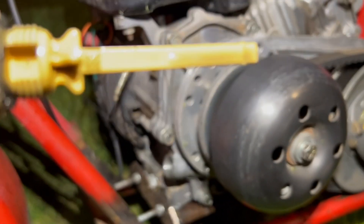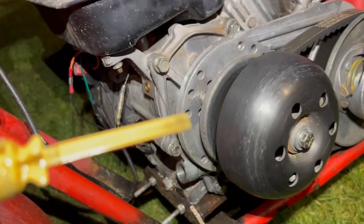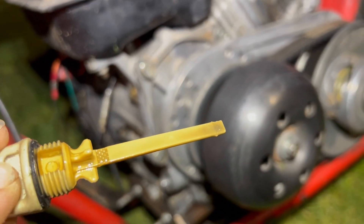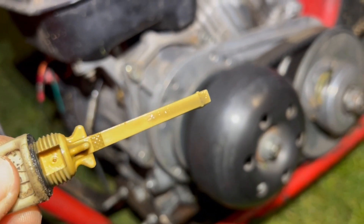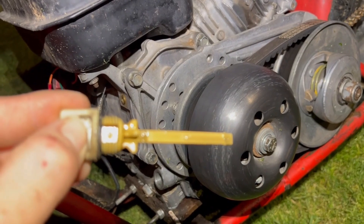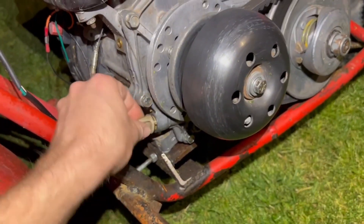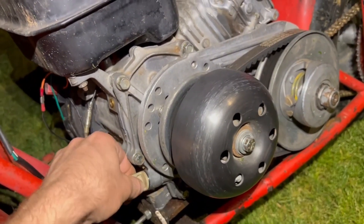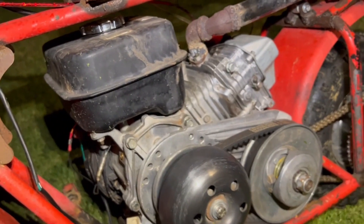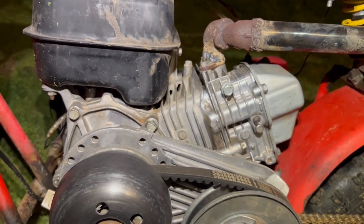There's some gray-looking glitter pieces in the oil — that's what I'm talking about, the metal shavings. But I can't find where they're coming from, so I'm just going to keep running it until something happens. I have plenty of clearance on the rod. I was worried the valve springs were too tight and were grinding into the cam, but there's no damage to my cam lobes.